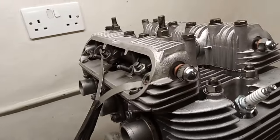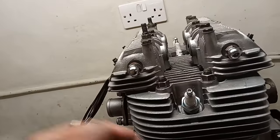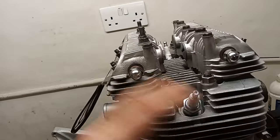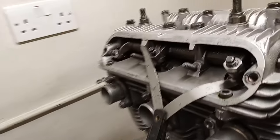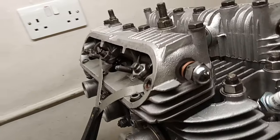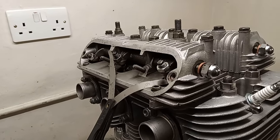Bear in mind that because I'm using a composite gasket, one of its weaknesses is that you have to re-torque the cylinder head almost immediately after first start, as everything loosens up. That also means I'll have to readjust the tappets fairly soon after starting anyway, so they'll all be rechecked and readjusted. I'm not too worried — I'll get on with this and see how we do.